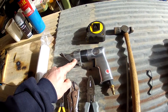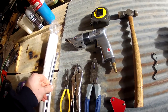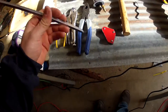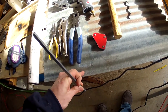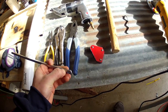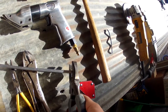You're probably going to want something to shear your tin — this one right here is a pneumatic one that runs off my air compressor. Obviously you'll need your galvanizing rod, and some heavy-duty cutters to cut the rod. I'm not using very much. If you watch videos of guys doing lead body work, they heat the surface and push the lead rod into the hole — this doesn't require that much. When you heat the rod it'll soften up right away, so you end up not needing a large chunk. I just take my cutters and chop off a small piece for what I need.